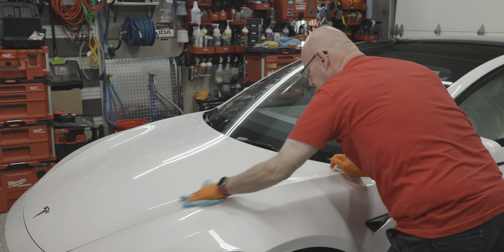Now, one of the things I learned yesterday was you got to really saturate this pad, a lot more than probably I've done with other coatings. So they recommend really saturating all on the pad, especially your first go around. So when you're priming that pad, you can see here, I've got it pretty saturated. Then I've got 2 towels for the leveling.